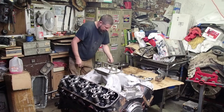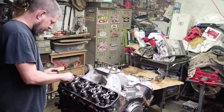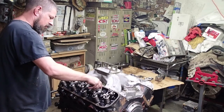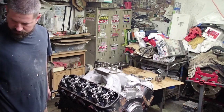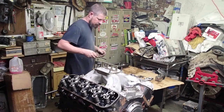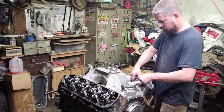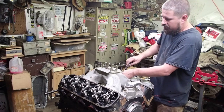The valve covers — they're really good parts holders, so I try to take them and put that side's parts in that side's valve cover. That right there does not look good, that is no bueno right there. Let's go to the other side and see what else is going on. It's kind of weird — the motor never developed a miss, but it definitely had a valve that wasn't opening and closing over there.